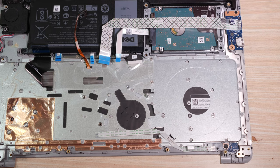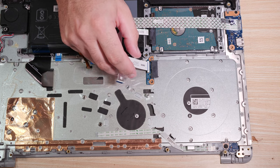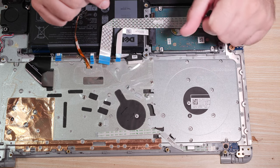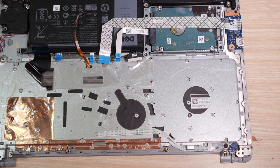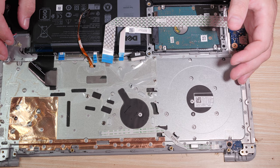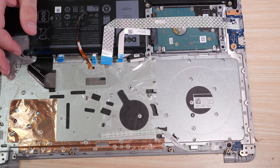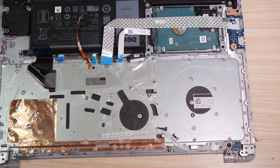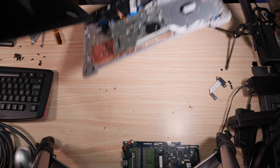We had a problem with the display cable not going in due to the optical drive, but then the optical drive thing also kind of fit under the display cable. So I think I'm going to put the optical drive board in after the display cable is hooked up rather than before. And let's check a few things real fast. The motherboard's not in yet. The shield goes in after the board. So do we do the display now or later? I would say now. Go ahead and get your display and put it.